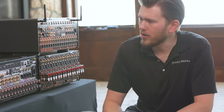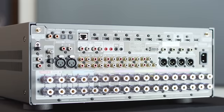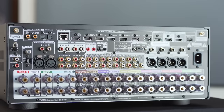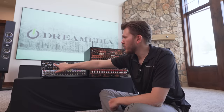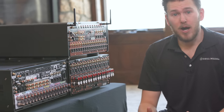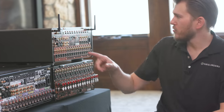Now let's check out the backside. Over here on the Denon A1H, we have pretty comparable ports. We have our Bluetooth and Wi-Fi antennas — I don't have them screwed in to the back of the A1H, but they would look just like the AV10. Next to that we have coaxial and optical connections for cable set, media player, TV audio, and CD, as well as a hardwired network connection. If you don't have a hardwired connection, that's okay — that's why they do have the Wi-Fi option. We always recommend hardwiring if you can. Moving on to the HDMI ports: we have seven HDMI ports, and they're all HDCP 2.3, 8K ports on both units, right across the top.